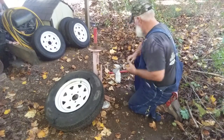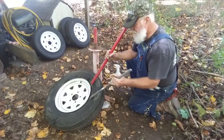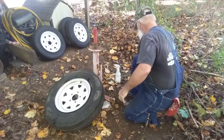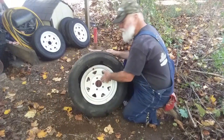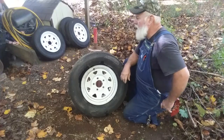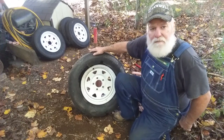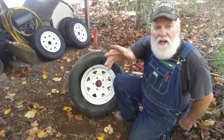You'll have to buy an extra tire iron because you're going to have to get in one spot and break the bead over, then keep working it over and keep going across just like that until you get the bead up on top of the rim. I just wanted to share this tool with you and show you how easy it was to replace a valve stem. I'll have four new valve stems in it and won't have to worry about it — the two of them were bad. Hope you liked this video and I appreciate anybody that watches my channel. We'll see you later.